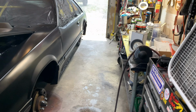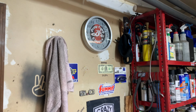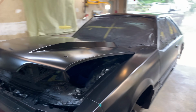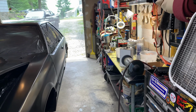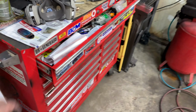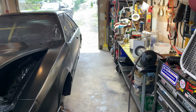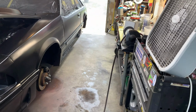In between the sealer and base coat, it says up to 1 hour. I'm at about 30 minutes at this point right now. So, yeah, I got the gun all cleaned up, ready to go. We're running a 1.4 nozzle on this thing. That's what the instruction says. It does come with a good set of instructions right here. So, yeah, tells you everything. Pressure for the base coats between 27 and 30. And, yeah, we're going to go from there.